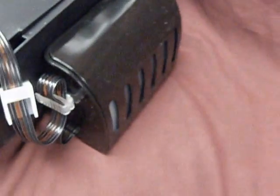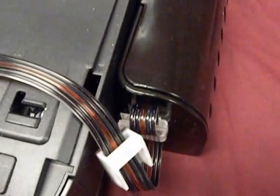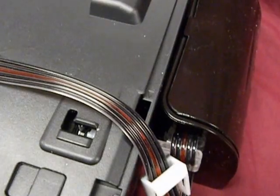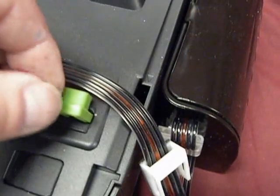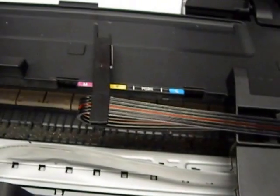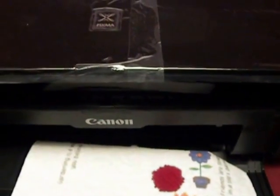Close it and push it against the side. When the lid shuts, on top of the lid there's a little tab that goes into the interlock switch, so the printer knows that the top cover is closed. But we're going to give you a little green jumper — push that in and then you'll be able to close the cover and print. The reason the cover is going to remain open a little bit is so the hose can travel freely without getting bound up. If you drop the lid all the way, the hoses have a tendency to catch and bind, so that's why we don't set up the CIS like that.